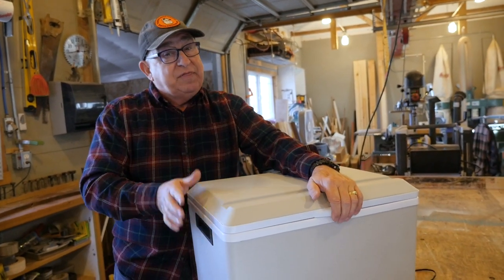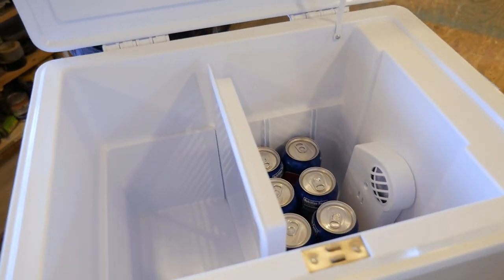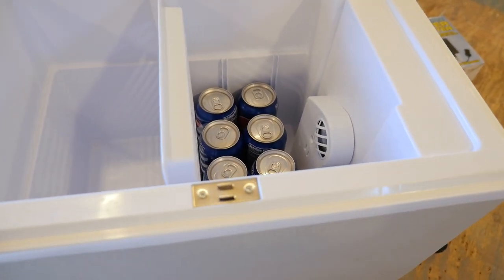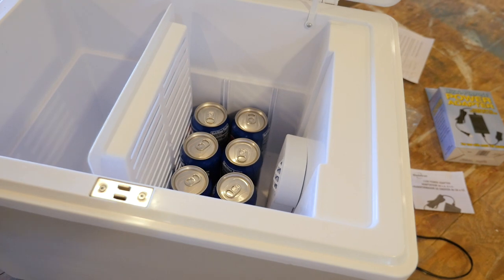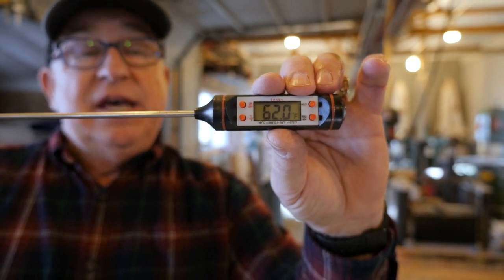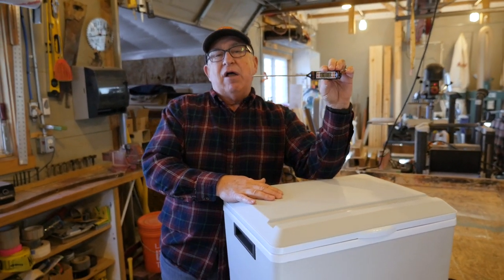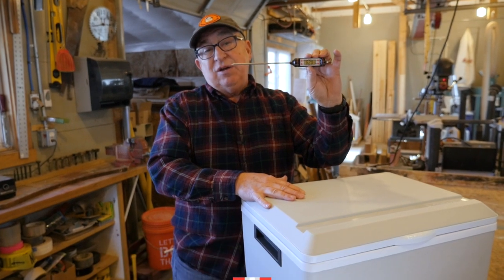Let's take a look at Coolatron's product. There are other thermoelectric ones on the market, but we're going to review this Coolatron product. This is Coolatron's Cool Caddy — it's a thermoelectric iceless 12-volt cooler slash warmer. You can configure it a few different ways inside, either using the rack to separate above and below, or as a divider to keep different items separate. The ambient temperature in here is in the mid-60s. What you should expect from this kind of cooler — it's not a true refrigerator — is to have it settle somewhere around 40 to 42 degrees Fahrenheit. Let's go ahead and stick this thermometer in there and see where it's chilled down.